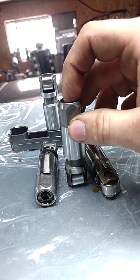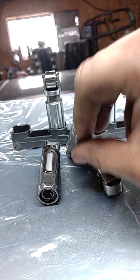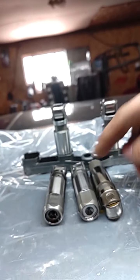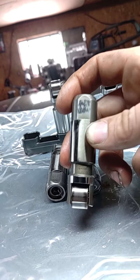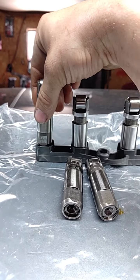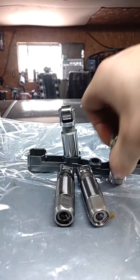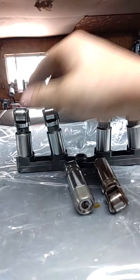So you guys that are paying $600, $700, $800 for these Hellcat lifters, eBay, 116 bucks. I've never had an issue out of these. And then here's your normal non-MDS Mopar lifter. While it's a different part number, it's identical, the same lifter. Here's the trays. The only way you can tell any difference on that lifter is it's used. It's a little bit brown. Then the eBay lifter: the only difference is you've got your bleed back hole.